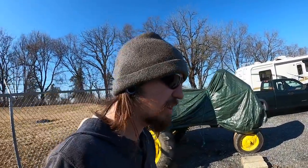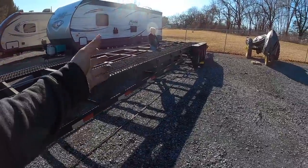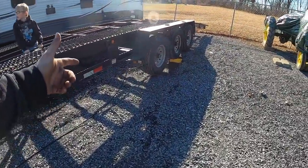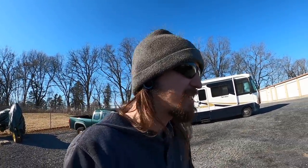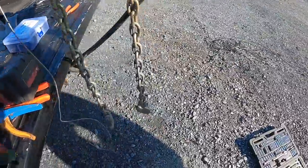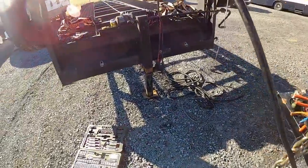Tell me if you guys think it might be overkill to add a third junction box. If I can add a junction box somewhere in this area before the brakes, and then add one back here specifically for these lights — let me know if that'll be overkill or make it more complicated. Junction boxes are great because they give you diagnostic checkpoints: it works to this one, great, move to the next one, check your connectors. They're only $10 honestly, so it's not a big deal either way.